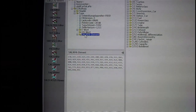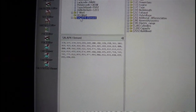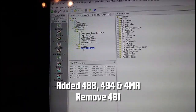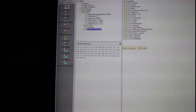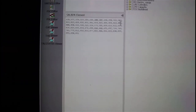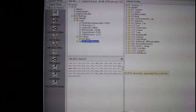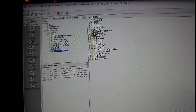These are all the option codes coded to the car. What I've added in here is 488, 494, and 4MA, and I've taken out the 481. Then you click on Apply Changes. So let's make the change - for 4MA, make sure that's correct, apply the changes.